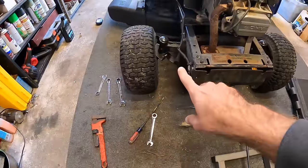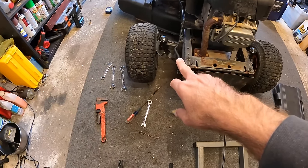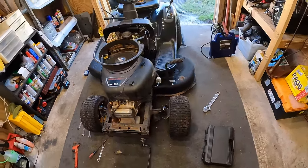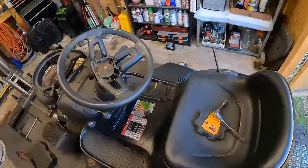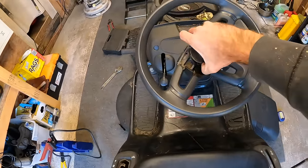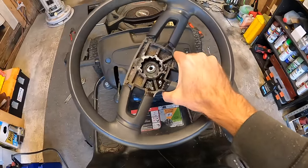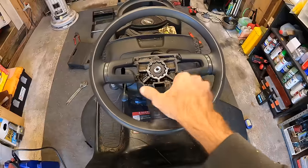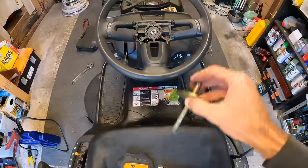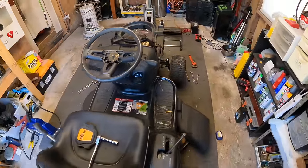I had to do a little more bending on that side, and I ended up going the opposite direction with the other side because I didn't want to go too far with the right side. I think we've got that basically as dialed in as I can get it. The steering wheel was still off, so I popped the cover off — half-inch bolt comes right up — and we're left with the gear pattern. I can just lift up on the steering wheel, get that centered up. Everything looks good there. I'll tighten up that bolt, put the cover back on, and steering should be pretty good.